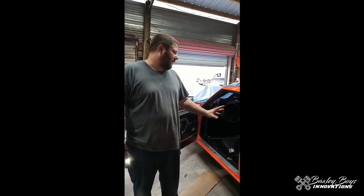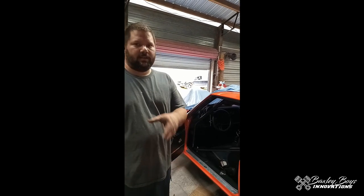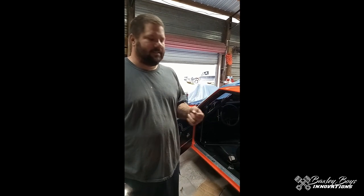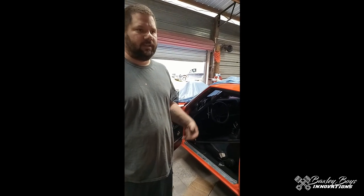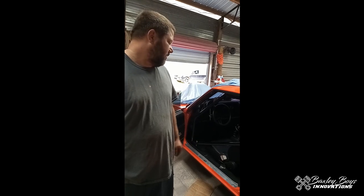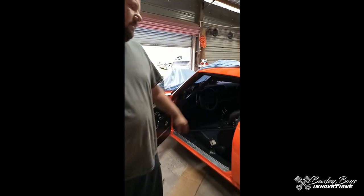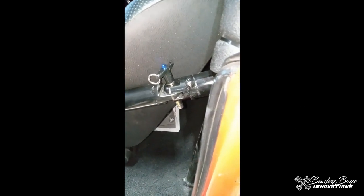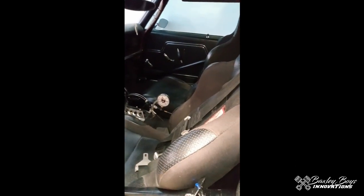We made it through everything, three days later. The car turned out really good, exactly like I expected. Everything painted, everything swings out evenly and latches easily. We didn't burn any of the interior parts, didn't scratch any of the exterior. On this side you got a pin here and here. On the driver's side, instead of bolting it we put pins in both so the driver can take it out when driving on the street and throw it back in easily for the track. On the other side, a bolt in the bottom and a pin in the top. Everything cleaned up real nicely — I'm very proud of it.